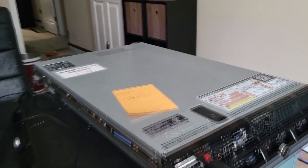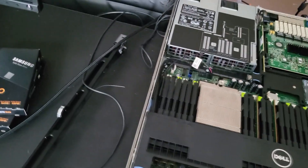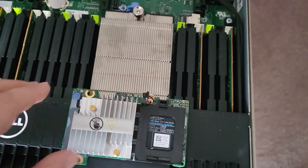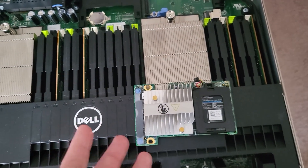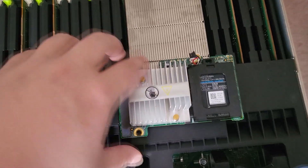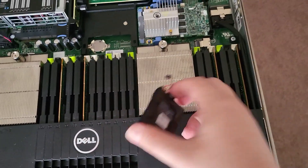So the first thing I need to do is open this bad boy up and take the battery off of the RAID controller because this will present some issues. This battery here — I've got it unplugged from the actual board. I'm going to take it off because I don't like batteries being around hot things and not being used. This thing caches the RAID information on the card — it's basically like a CMOS for the RAID card. So we want to take that off; it's not going to be used anyway. The battery is removed, so now we can put the top back on loosely and begin doing some actual configuration stuff.